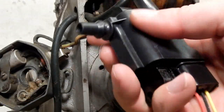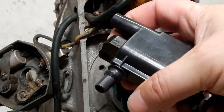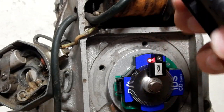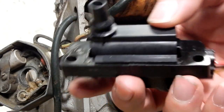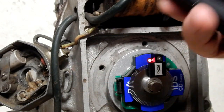This is a wasted spark coil with two towers. It's very, very thin compared to our old coils — extremely thin and very light. There are two mounting holes and you only need to use one if you want to, or you can zip tie it in place, or fasten it however you want.